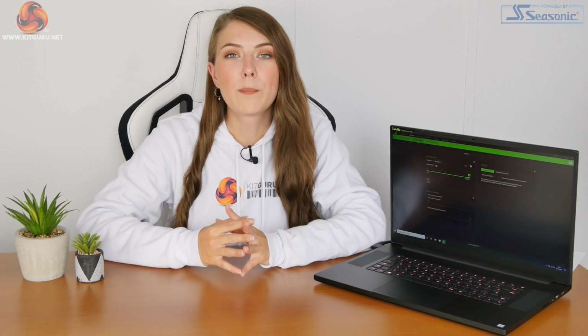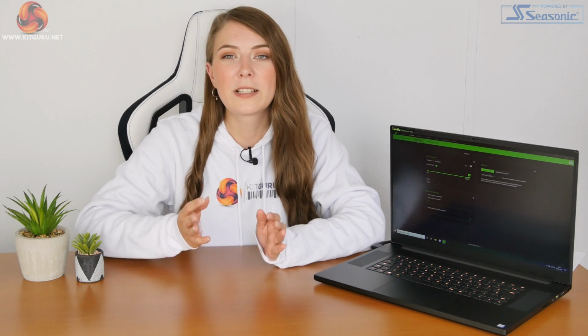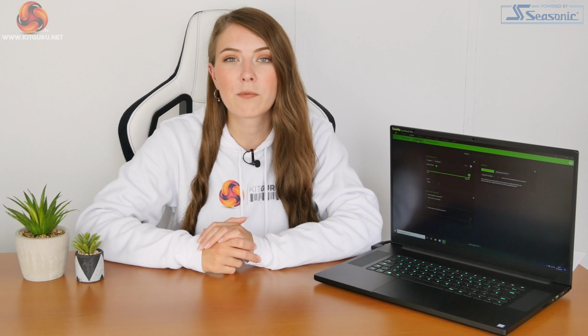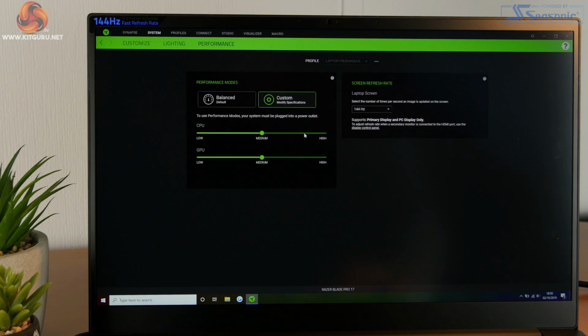So all of my testing on the Razer Blade was conducted using the high performance profile. This isn't something that comes automatically with the Razer Blade. So if you do happen to pick up one of these laptops, to get the best performance, make sure you do go into the Razer Synapse software and change it from the balance profile, go onto the custom tab, and then there's two sliders for CPU and GPU. I slid those both up to the high profile, and that's how you get the best performance out of the components that are inside.